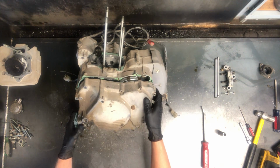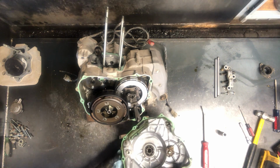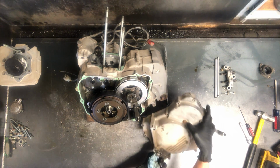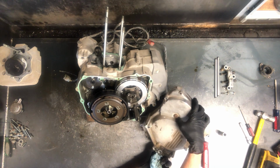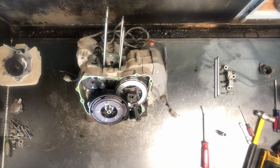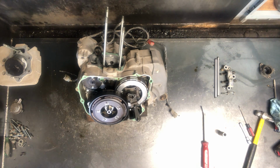tap. And that is your cover there. So that is your cover. There is your clutch adjust. I showed you in other videos how to adjust that clutch, so check those out. It takes a 1 1/16 socket. Deep well is probably preferred here, but this actually is going to work.